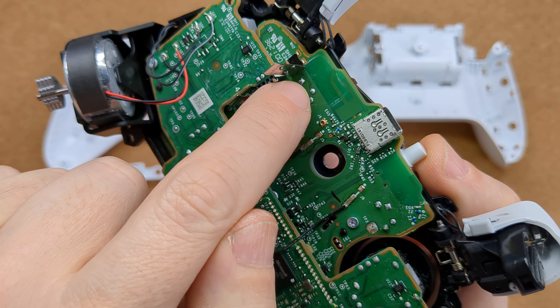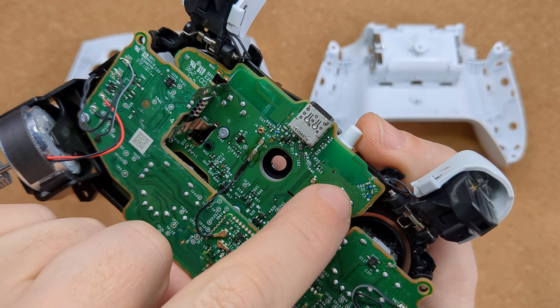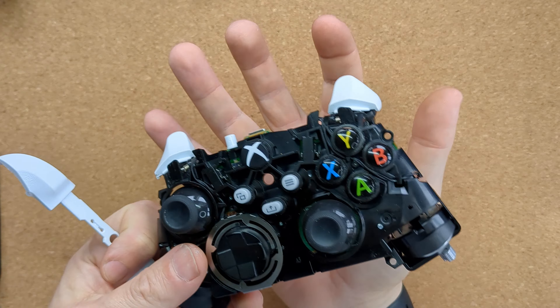As a quick aside, if you look underneath the controller PCB, you can see four solder points on either side where the switches are attached — pretty big solder points, so these switches are well anchored in place and the components themselves are fairly substantial. They've got a rubber cap on the button part, so I think these are unlikely to break in comparison to the thin plastic tabs on the bumper strip — so that's usually going to be what's at fault if your bumper's not working.